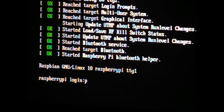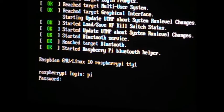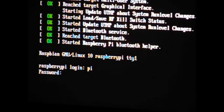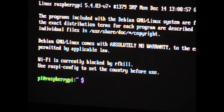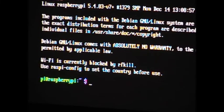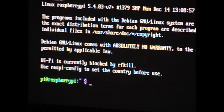But you get the idea that Raspberry Pis, as other Unix machines and Linux machines are, they tell you everything they're doing. So here I'm zooming into the command line, and I'm going to put in my credentials here, pi, and then the default password, which is raspberry. You definitely should change that for any kind of production application. And then I'm going to install Open Media Vault from the command line. And this will be a little bit awkward. I apologize. It's kind of a long command. Many people comment about this.